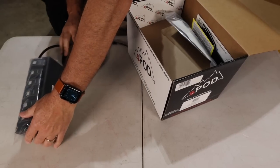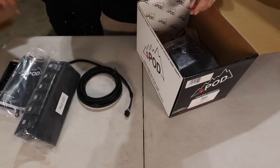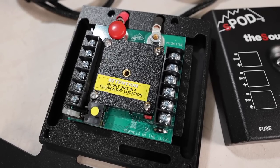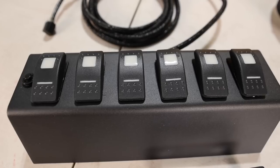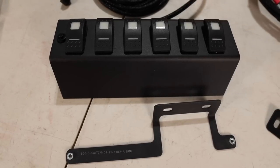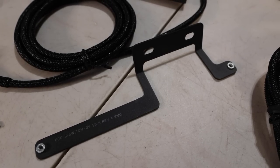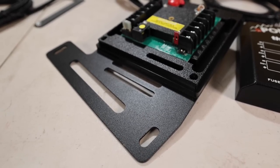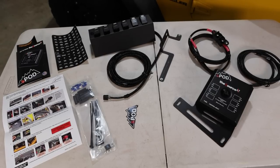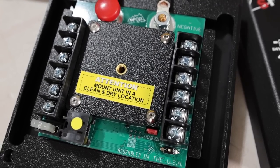First up, the S-Pod Source LT system — chosen because it is vehicle specific for the Jeep Wrangler JK and should be an easy plug and play. This system has six circuits, meaning we can attach six different accessories and operate them independently on 30 amp circuits. The rocker switch panel is specifically designed to mount in a certain location in the Jeep Wrangler and has dual LED light switches, making it easy to see in the evening. The controller cable is 10 feet long, everything is powder coated, and all wires are wrapped in high temp abrasive resistant nylon. It also features a low voltage cutoff, self-healing fault protection, and protection against overheating, shorts, reverse polarity, and field collapse.